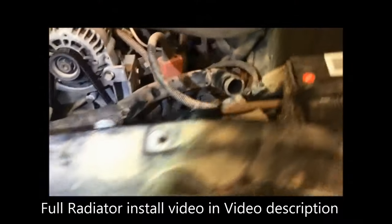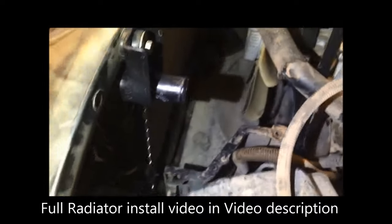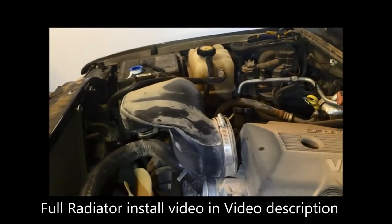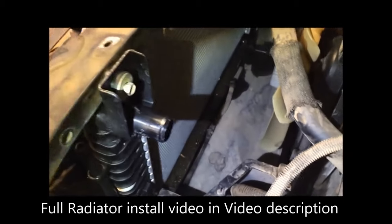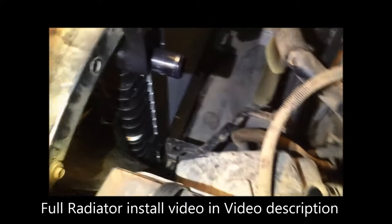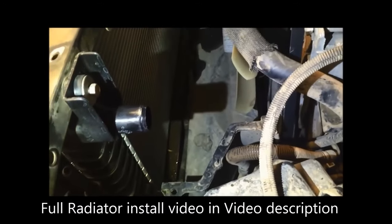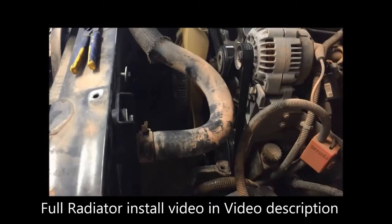As we come over to this side, we have this hose that goes back into here — this is where we're going to fill the radiator. A lot of mistakes that happen with these is people will go and fill the overflow tank and that's it. If you do that, it will not fill the radiator entirely. We're going to use a hose here and fill the majority of the radiator until it's about to overflow, then pour coolant into this hose so it goes back into the engine. You don't want air in the system.